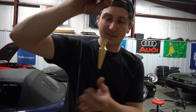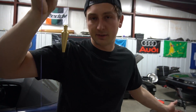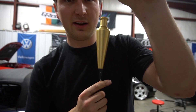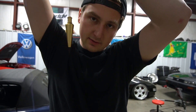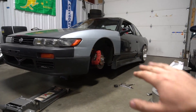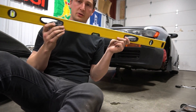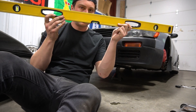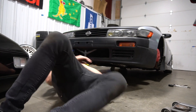I remembered a trick I learned from hanging out with my drag racing buddies: using this chunk of brass on a string, also known as a plumb bob. With this little piece we'll be able to efficiently and accurately adjust my caster on my 240SX. The first step is we have to level the chassis — front to rear ideally, but we're at least going to level it side to side using this big level on the frame rails.